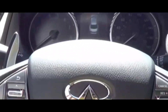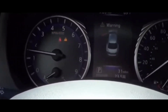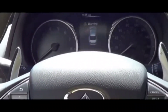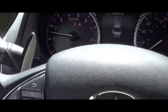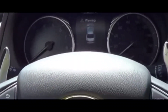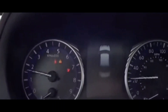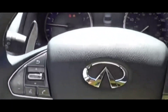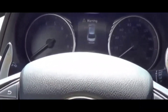If the tire pressure is good on all your tires, the TPMS sensor likely needs to be changed. It's rare that people replace just the battery — most of the time it's easier to go to a tire place and have them swap out the sensor. Actually, changing out the TPMS sensor itself really isn't expensive; it'll probably cost you around twenty dollars. The expensive part is reprogramming the car's computer to read the new sensor.